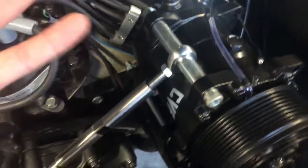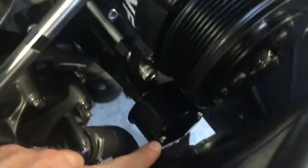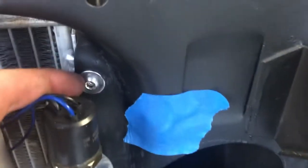When I mounted the idler pulley and put the cover on, the little allen heads were hitting the fan — tink tink tink. So I cut into this front core, removed the part that curves inward, and used a hammer and dolly to knock it forward. I probably gained about a half inch of clearance, which should be plenty. I also installed rivnuts so now it's just bolts — no wrench needed on the back side — and it comes out nice.